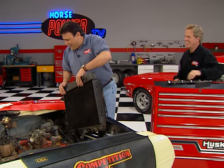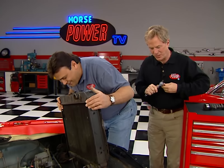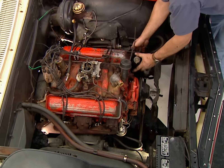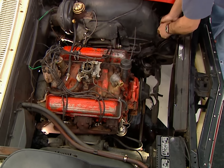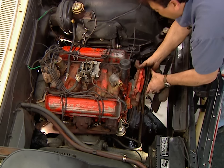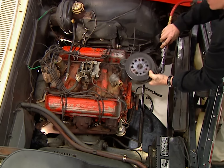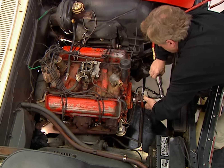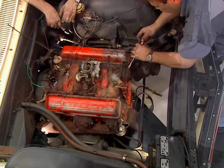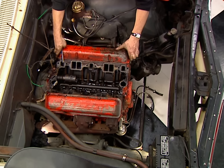Hey man, aren't you ready for this yet? No, I ain't that fast. But I tell you what, if you give me a hand it won't be long. We still need to remove the alternator, set the power steering pump aside, then get rid of the water pump. We remove the bottom pulleys, the balancer, the distributor comes out, then the intake, and the valve covers.